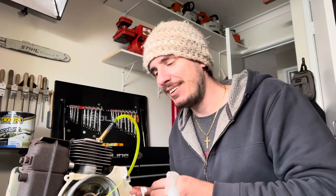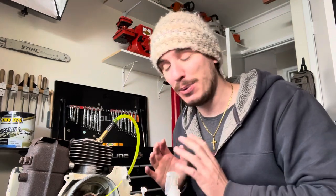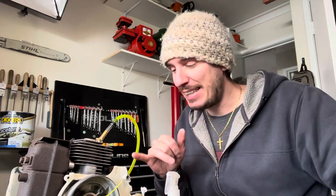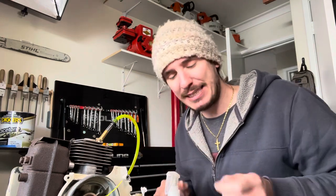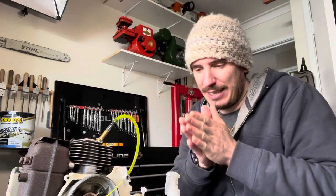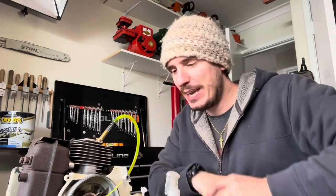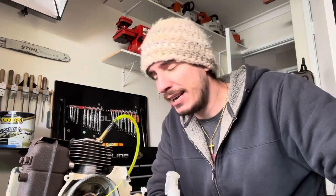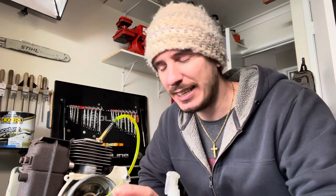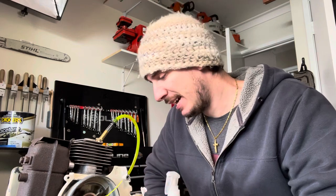It's a great tool and so important. Even though we've rebuilt this engine, it doesn't necessarily mean that just because we put new gaskets, new seals and everything, that everything's going to work fine. I've put new OEM seals on saws before and they've leaked. I've put gaskets in place and they've leaked. That's why I now always use Permatex number three — that brown liquid that you saw me spreading on. I had a leak between where the cases joined and I'd cut the little excess gasket off. From now on I'll always use Permatex number three regardless. I've not had a leak like that since.